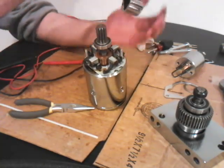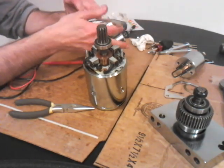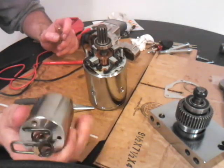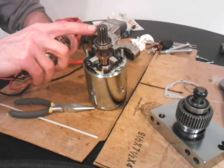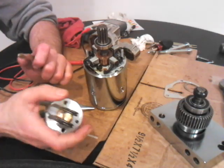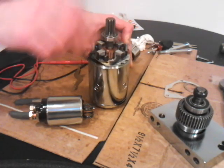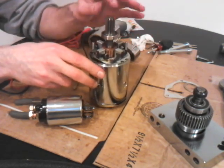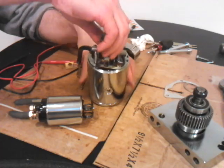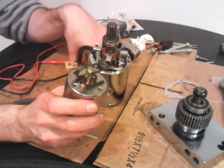Now take your lever. This lever is controlled by the solenoid. One other thing also — make sure these gears are good. Make sure there's no scoring or chipped teeth or anything like that, and just grease them a little bit. Over here, make sure this bearing turns nice and freely with no binding or noise — it feels smooth. Same thing with the bearing on the bottom of this housing. Make sure when you turn the whole commutator, that's good.